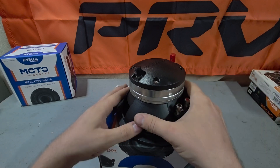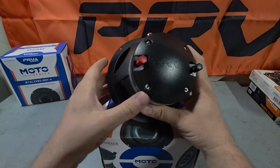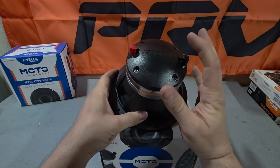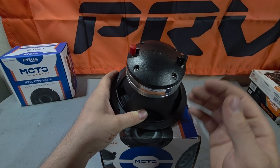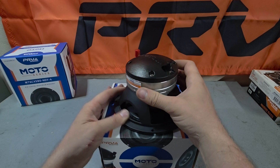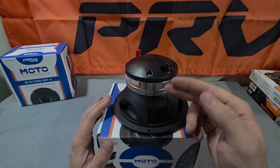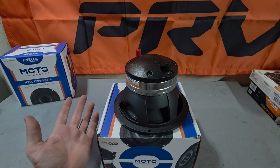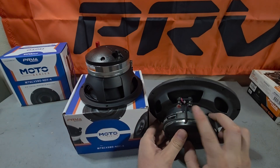Let's talk more about the compression driver. The compression driver handles the high frequencies that a tweeter would handle, and this actually uses the same diaphragm as a D280 Ti. This is loud, it's clear, and it can take some decent power at about 80 watts. But because the driver is separate from the speaker, you can definitely dial it in on a crossover. You can have them playing their own frequencies and you can also balance the driver with the speaker so that one's not overpowering the other — something you can't really do with a built-in coaxial such as the D380 that has the tweeter and speaker wired together.